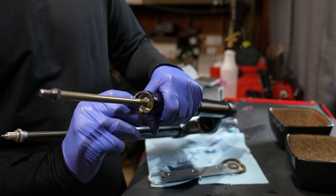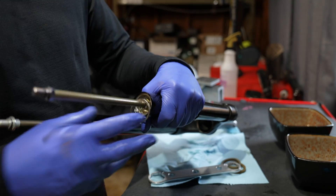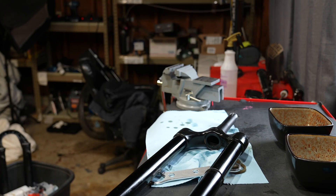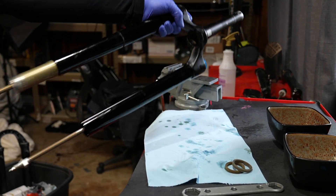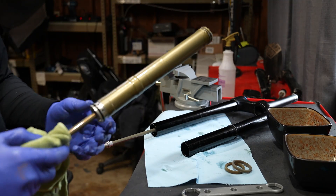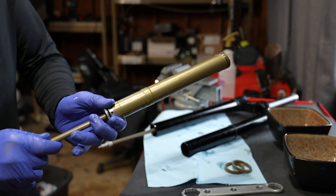The goal on this ring is to pry up one part of it and then the rest of it will pull out. It's kind of a two-piece ring holding the air spring in. Once you get the ring out, you can pull the air spring cartridge assembly out — it's gonna take some force because I probably didn't release the pressure from it correctly. That's the Fox 38 air spring — a super unique design.